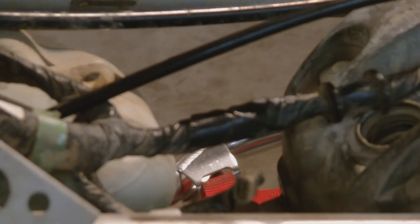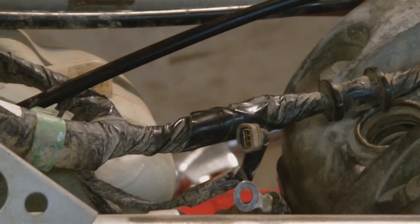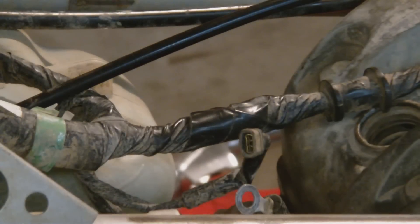You take off these and you have your coil right here with your spark plug wire and all that. You check your spark plug wire - I clipped mine and made a little more wire exposed because it was kind of torn up, just to eliminate that variable. That variable is eliminated, so that is not a problem anymore. You can grab the wire and run it through to test your resistance or ohms through the coil. Since I know this coil works, it's not the coil's fault - it's something else.